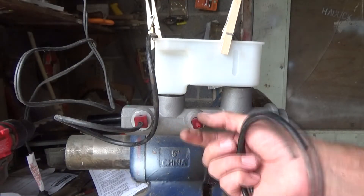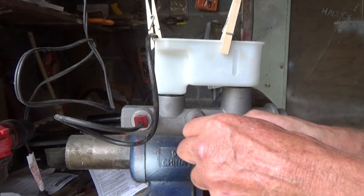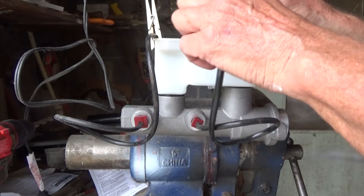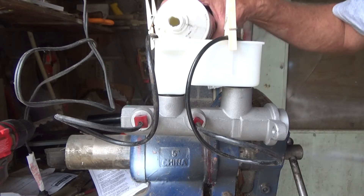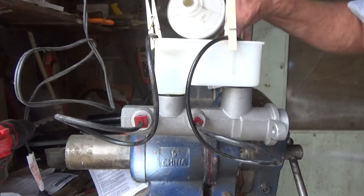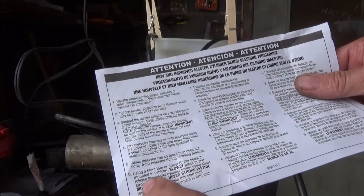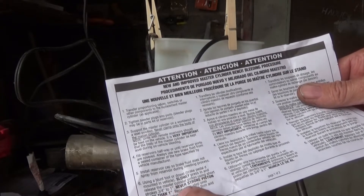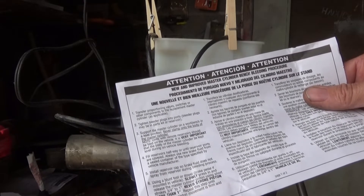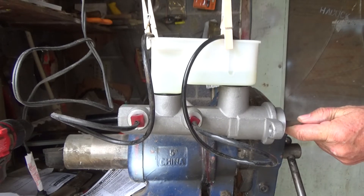This kit is to bleed our brakes — it's just plastic tubing. I blew through it to make sure there's no dust in there, then put it in to keep the fluid circulating back in. I filled it about halfway with fluid. The directions say: slowly press in and release the master piston using short strokes of three-quarters to one inch — never stroke more than one inch — repeat until resistance is firm and movement is less than one-eighth inch.